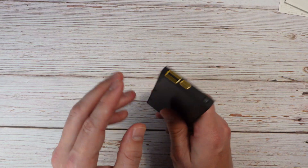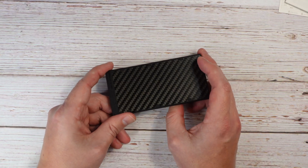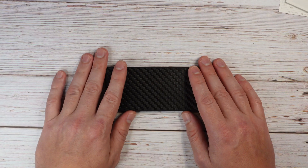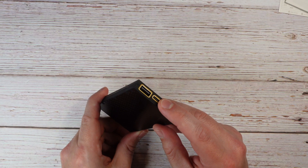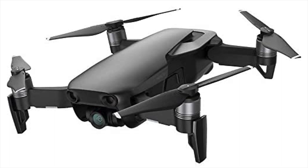It's a 10,000 milliamp hour battery with USB-A at 18 watts and USB-C at 20 watts. In terms of real-world charging: a standard phone will charge around two times; a really large phone like an iPhone 14 Pro Max will charge about one and a half times; headphones, AirPods, and small cameras will charge four to five times. Larger products like laptops or a large drone won't fully charge, but this is good for topping those devices off if you need a little more juice to get through the day.